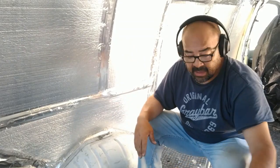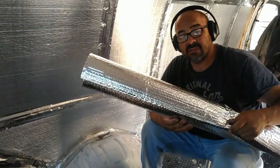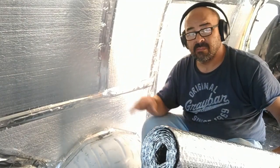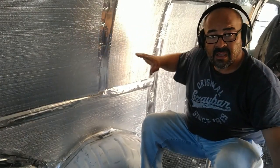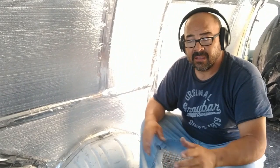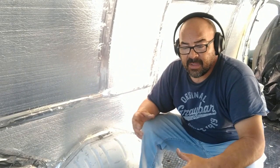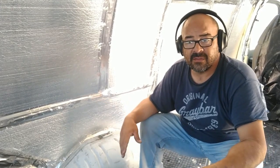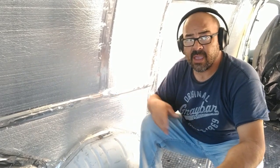I'm gonna put it all back up again, and now that I did take it down, I'm gonna try to do this right. I know this is not the greatest insulator, but the reason I'm using it is to put it as an additional membrane keeping any fumes and gases separate from outside and inside. I don't want anything coming in while I'm sleeping — I do plan to have alarms but it's better to just keep it out in the first place. Since nothing can pass air-wise, it also works to maintain temperatures because there's nothing coming in bringing heat or cold from the outside or escaping the other direction.